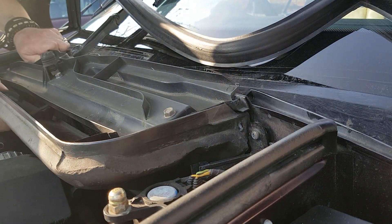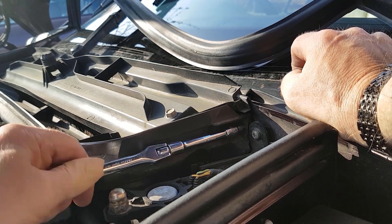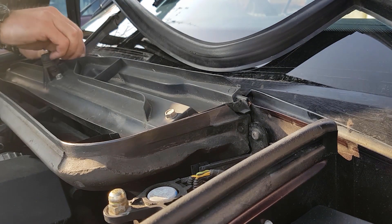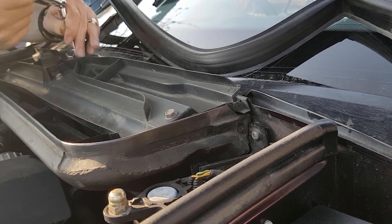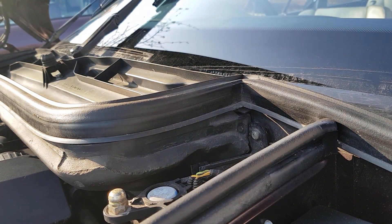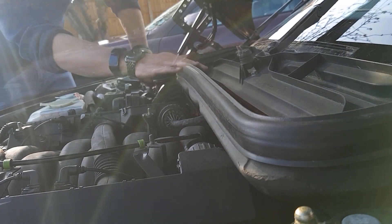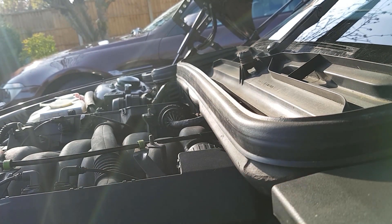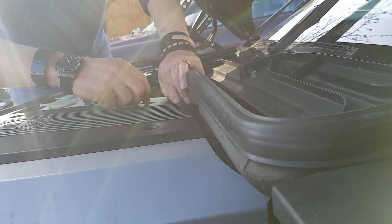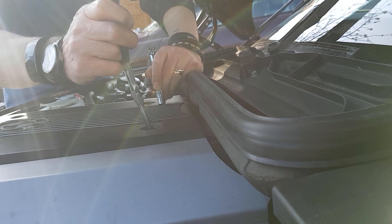Then we put the microfilter cover back on again. The hardest bit is getting the seven mil self-tapping screws in without losing them, so be careful as you do it. Both of them in — conical nut is nine mil — don't do it up tight, just enough so it starts compressing the forked bit of metal. The cover seals back on. Magnets on that so I don't have to worry about it. So much more simple than taking the manifold off — that's it, thanks very much, see you next time.